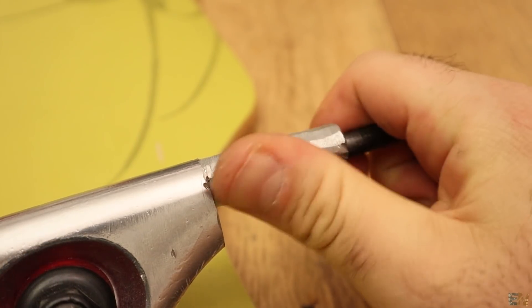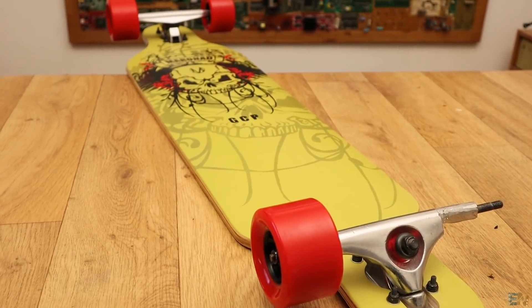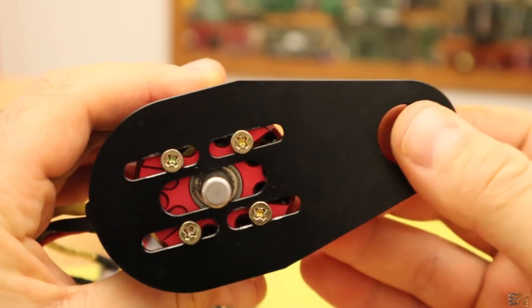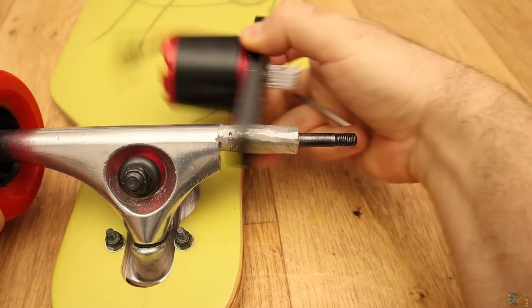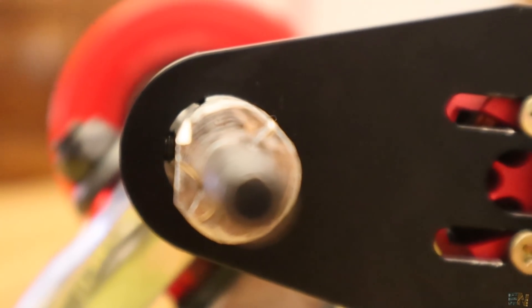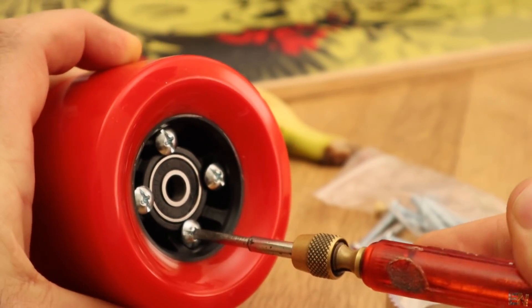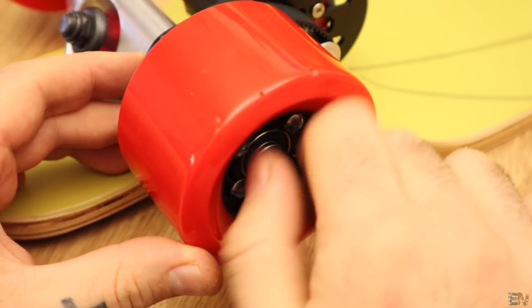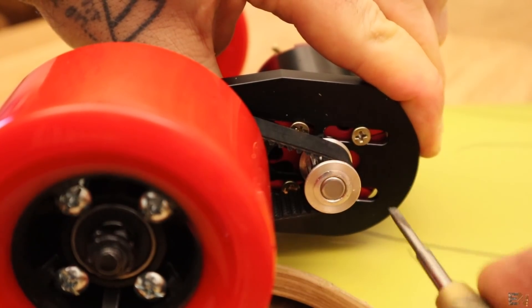I first cut a little bit of metal from the longboard shaft so the support will fit, and I also change all the stock wheels with the bigger ones that have holes for the pulley. I screw the motor to the motor support but don't tighten the screws too much so the motor can slide side to side. Then I add the small pulley and screw that tight. I add the support to the shaft and fix it in place with those 3 screws, but not too tight. After adding the pulley and the belt, I pull the motor backwards until the belt is very tight, then tighten the motor screws.